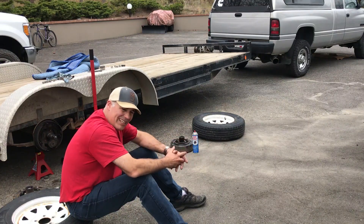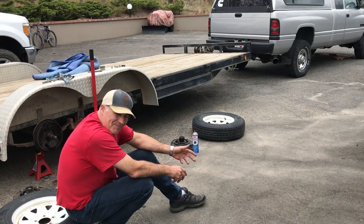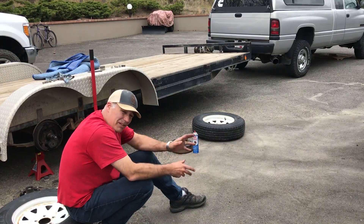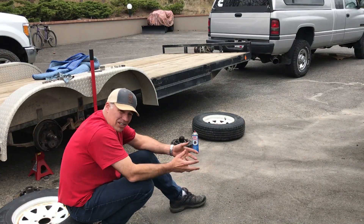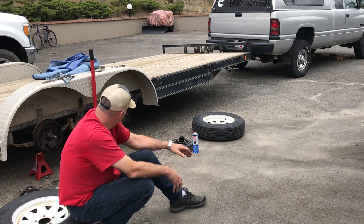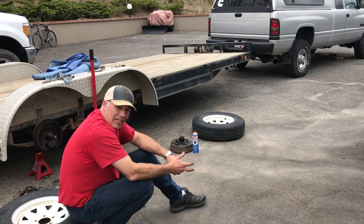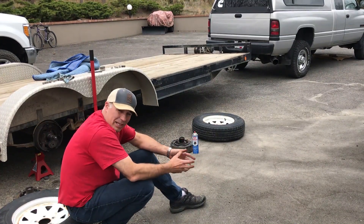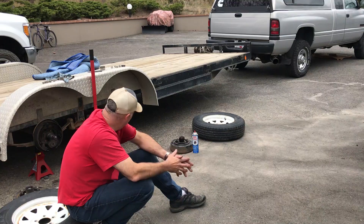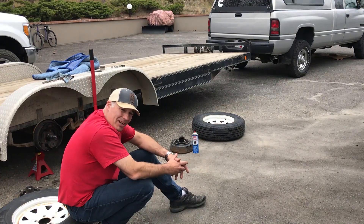The brakes are a little weak on this trailer. I tried to adjust them but wasn't getting much improvement. I tried the breakaway switch and it didn't work. Time to dig in. This trailer's been sitting for at least a year or two — with COVID restrictions, no car shows, everybody staying at home. The trailer's been sitting and rusting, so all the brake linkage inside is seized up. I pulled the drums off and repacked the bearings, and I'm going to fix all the linkage on the brakes. I went and picked up a brand new breakaway battery yesterday — the old one was all corroded, one terminal came off in my hand. So I'll fix all that up and have a good, safe trailer. Here we go. This is the start. Thanks for following along and subscribing. This is an exciting video for me to make.